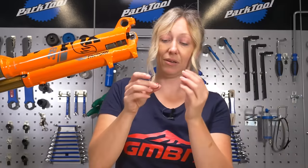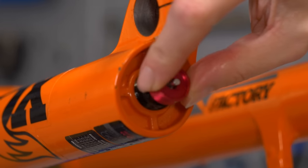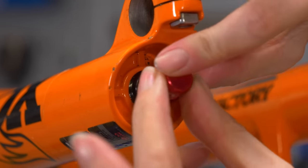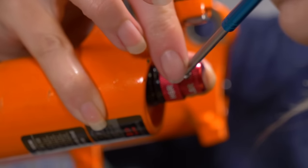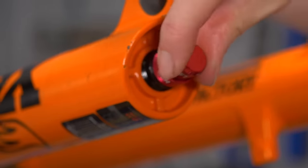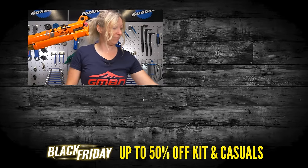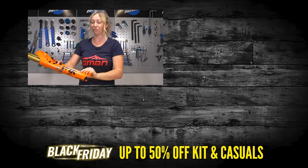Then it's the rebound dial — put your big bit on first, make sure it's the right way round, and it should slot onto the bigger bit. Then you've got your spring and your lower dial. Sometimes these can move in — just make sure it's out enough. Then it's back to the two mil allen key, and bear in mind this is a tiny tiny bolt with no more than two newton meters — it's just nipping it up because that thing is not going to come off. Clean her up, pop the cap back on, and they're ready to go back on the bike all nice and refreshed.